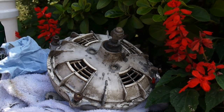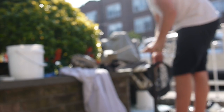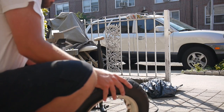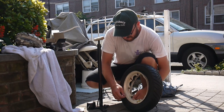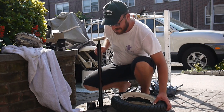My new line of thinking is to get everything apart and then put everything back together as soon as possible. I used a simple bicycle hand pump and a BGM Lambretta-specific tube that I got from Jet 200 in Denver. I pumped up the tube just a little bit to get the inflation started so the rim doesn't pinch the tube. I tried fitting the rim halves together. I think the standard procedure is to position the valve opposite the label of the tire brand — that detail shows that you're serious and paying attention. These tires are about 10 years old; I bought them at P-Town Scooters when I lived in Portland.